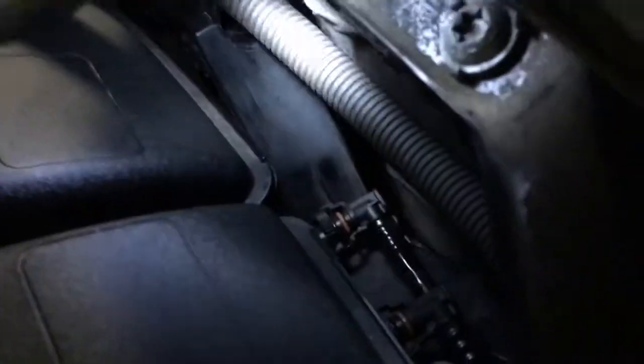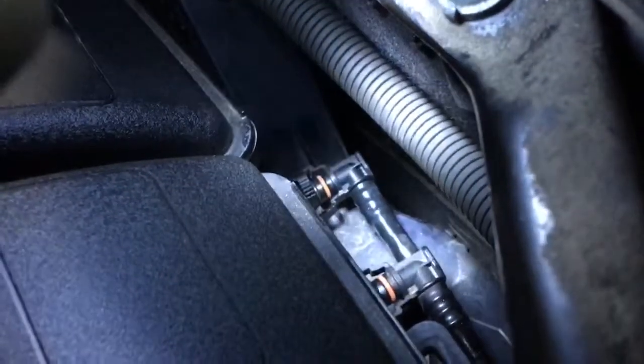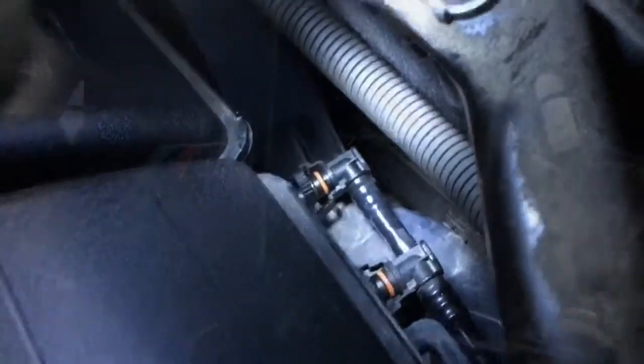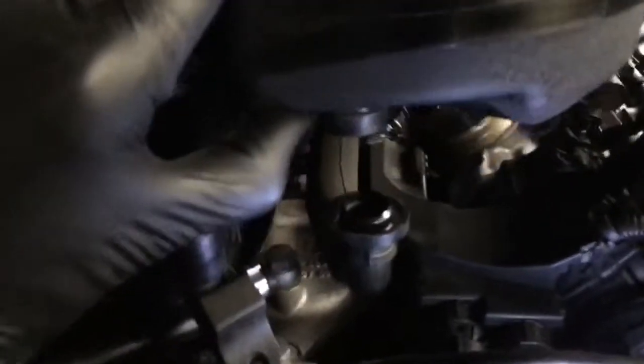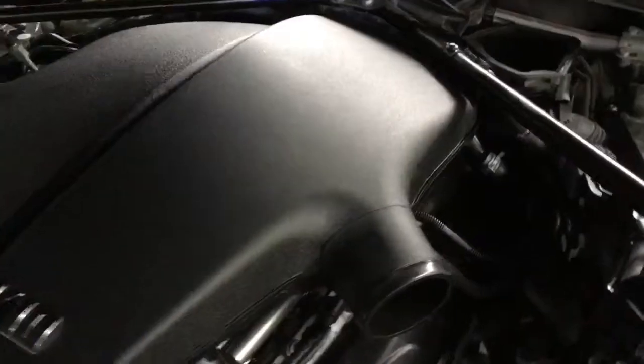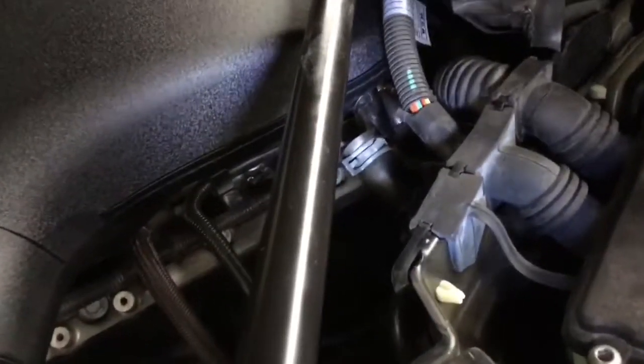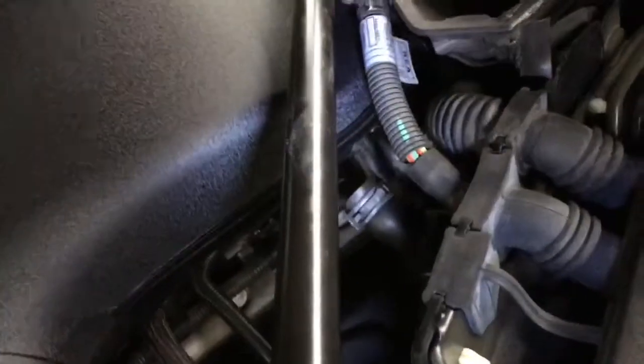There's a small electrical box over the back here. It needs to be lifted up and off the back of the plenum, right down the back there. Now you can reach down the back of the plenums here, undo these 2 hoses. Just press the plastic clips and pull them off. Just be gentle because they do break easily. Lift the front up. And there's a hose to disconnect at the front there, one on either side too. There's another small hose over the back in the corner here with a crimp connector on. I was able just to pull it straight off without removing the clamp.